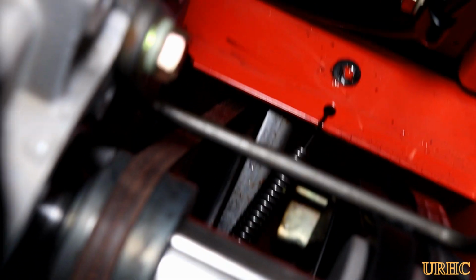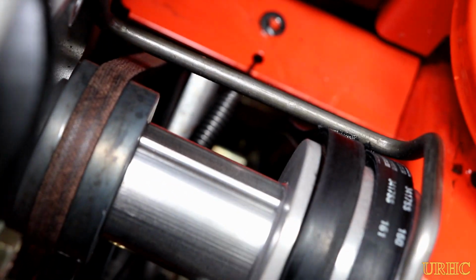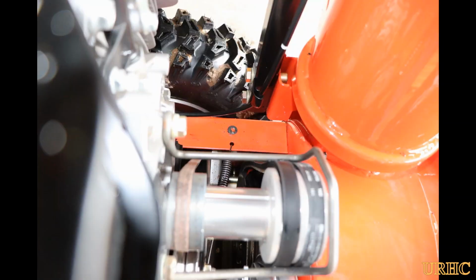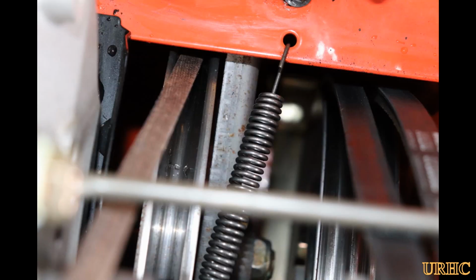It's funny, yesterday somebody told me that my old model was a 1962, and that never had one drop of slippage, one problem, or one issue with the drive system on it. They really did mess something up here. And if you look at this, you can see that belt to the left there. You can see how it goes cockeyed down to that bottom pulley when it's just spinning there idle. There it is right there, the misalignment on it. So you do get spots on it from when it's just slipping and it's not engaged or anything, and there it is. And then everything pulls back.